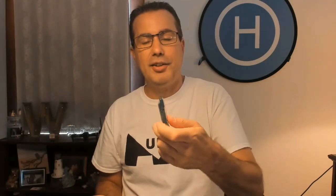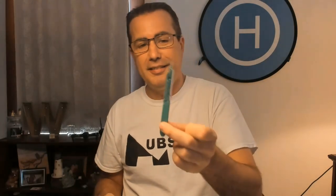This is actually a surgical scalpel for cutting people open. Not me, but my brother works at a hospital and he supplies me with these. These are great for the hobby. But I simply just take this and I cut the edges where the plugs are, where they have glue. Loosen up that glue. Just give it a score so it has a place to break loose. Then pop it free and you'll notice it'll pop and break the glue right where you scored it with your razor knife. You just always want to be careful and not slip and cut other things.